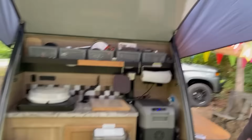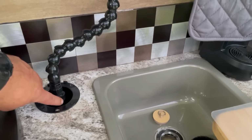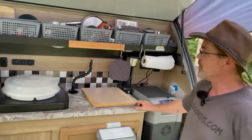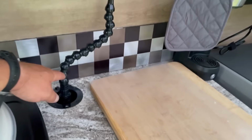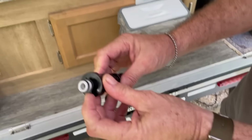So now you got the same thing that I do on here. I have a valve on mine. Every time I show one of these, I've been mentioning to people, the earlier trailers had the Durafaucet connection, like mine. The newer ones now have different automotive connections. People have been chasing them down. The best advice I can give is to go to Home Depot, Lowe's, Trading Post, Ace, and try to find the exact fitting that your hose came with. This quick connect is the Durafaucet style. The new ones are all different, so it's hard to point people in the right direction.